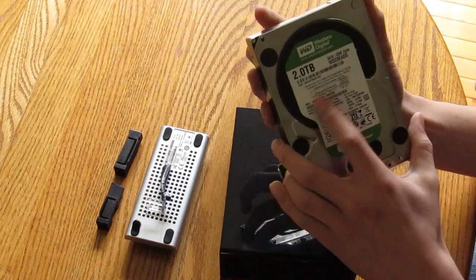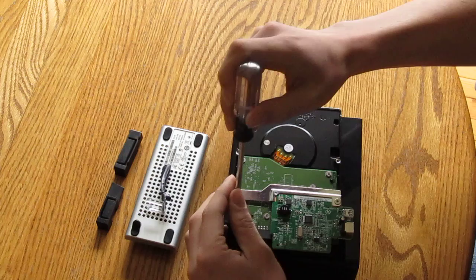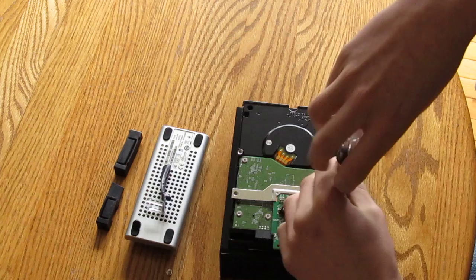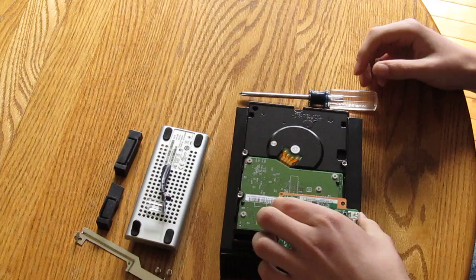Anyways, if you enter the serial number and model on their site, you won't get warranty for it — period. You have to contact HP even though it is a Western Digital drive, unfortunately. So the whole beef about this was removing the CD drive emulation, the fake thingy that's on here. The reason they did that is because Autorun on Windows will automatically run the software off a CD drive, whereas a hard drive it will not — so I guess that was their intent.